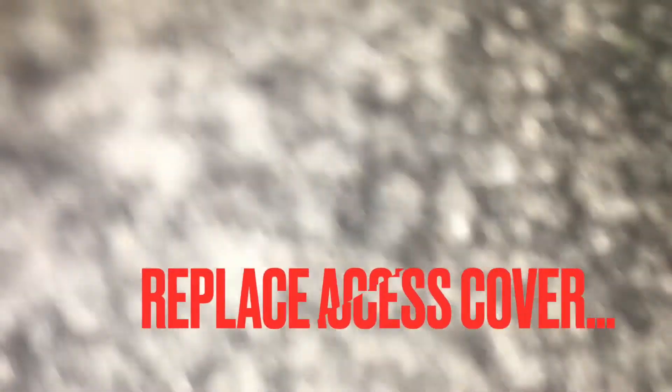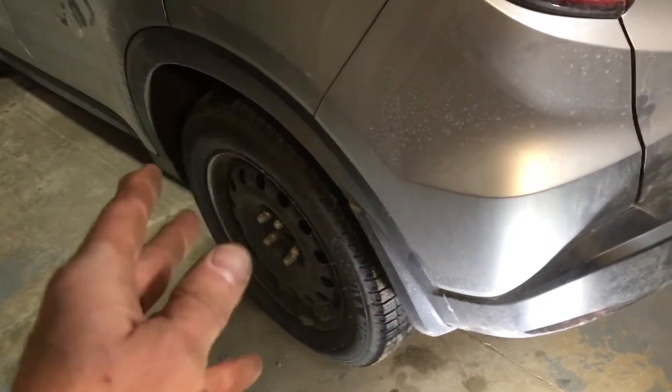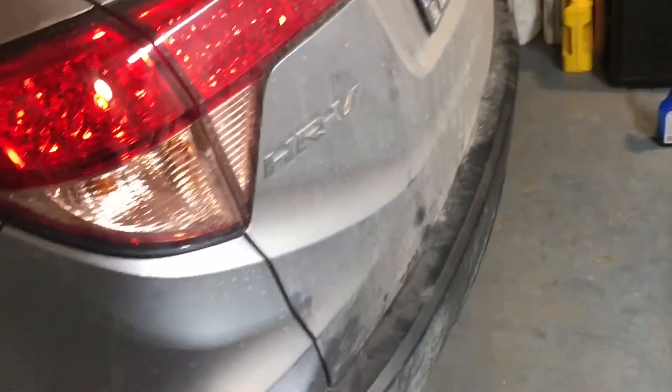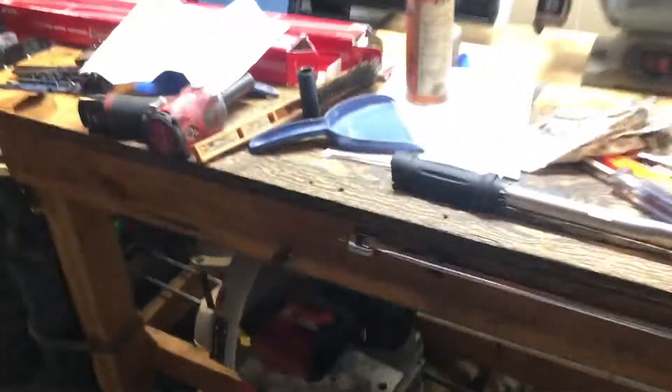I'm doing this with one hand here — sorry, I realize you can't see much, but I think you can hear the click. That's it. First side took me, in all honesty, probably 45 minutes to figure out the drawing, get everything, jack stands and whatnot. Second side, maybe 20 minutes. For a dealership to do this — keep in mind we're talking per side, one bolt and one nut, getting the stack correct and torquing it up — an hour's labor realistically, assuming you're dealing with a 2018 car in reasonable condition.